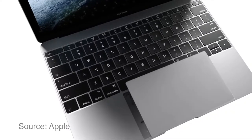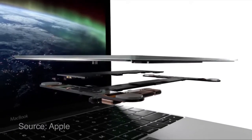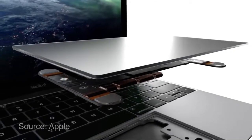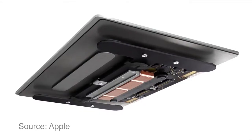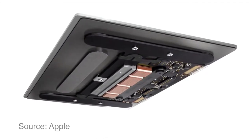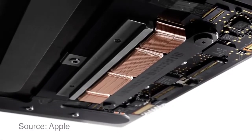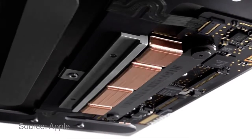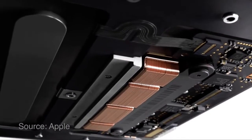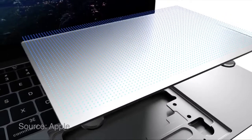So what exactly makes the new Trackpad 2 so expensive? Well, it starts with Force Touch. The same technology that has been added to the MacBook Pros and the new MacBooks now makes it to the desktop thanks to this accessory. That means we no longer have a full physical click in this trackpad. It's now replicated via a taptic engine. There's actually an electric motor underneath the surface of the trackpad that simulates a physical click.